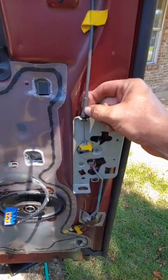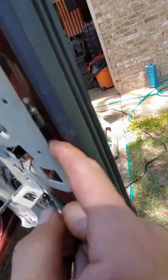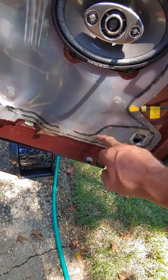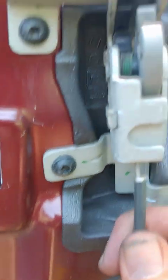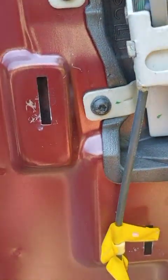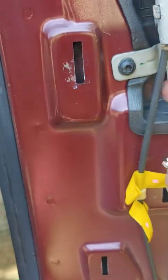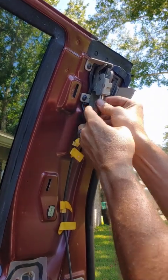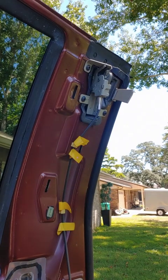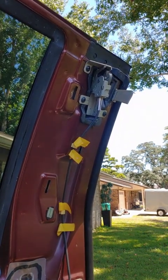Here's what we've got to replace. This one is okay, this one failed, failed. It goes up in here, and then there's another one that goes down this cable inside the shielding to that latch. This is the piece we need to do — there's a cable in there which you're going to slide this piece around, then down onto the shielding. Slide it in; you'll see the slot on the inside and give it a little bit of a twist. I sprayed this with WD-40 and now it doesn't bind at all.